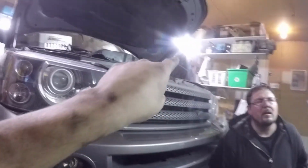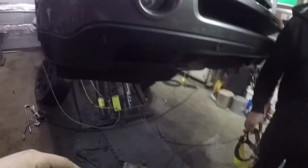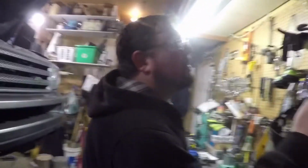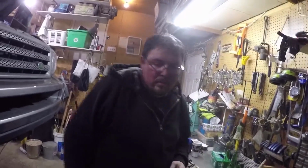We will inflate the suspension through the software, and we will then be able to do the full torquing of all of the bolts. You don't want to lower it onto ramps first? Yeah, we can lower it on. We need to lower it on the ground because it needs to recalibrate the air suspension, and when it's calibrating, it needs to be leveled. So, I guess we'll put it on the ground and hope for the best.